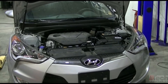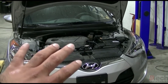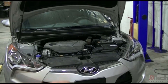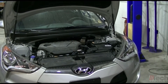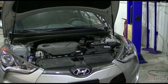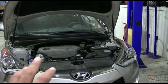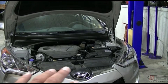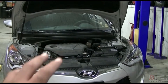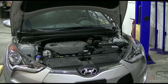But we're here now. I'm betting these two actuator motors are the same — we'll compare the ohm readings. The only other possibility is an open in the wires from inside to the motor, but if that's good, I'm betting we're going to need a transmission control module. With these supposed two new good motors, which we'll verify, we won't need to do anything at the transmission itself. So we'll pull apart the interior, get access to the module, and start making some checks there.